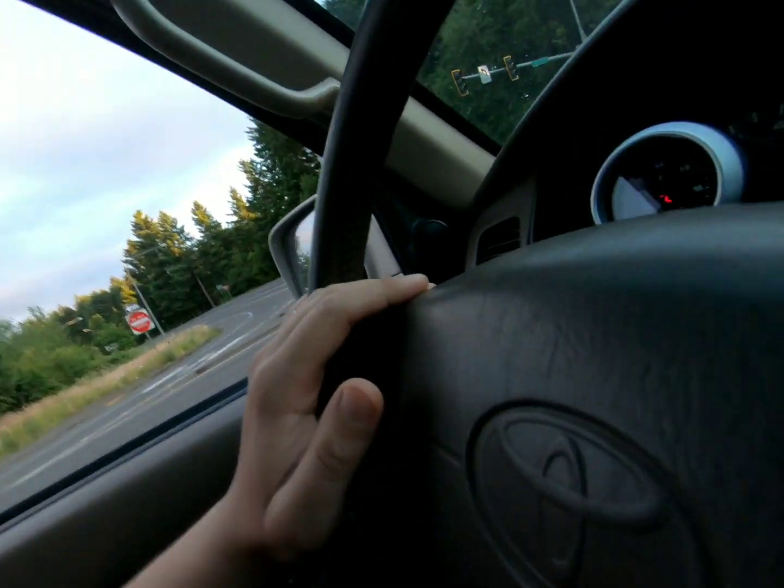So there's conflicting stories with this, and some people it does work. Some people, stock ECU works. Okay, I'll admit that, but I'm just saying mine didn't. So if you plan on turboing your 4runner, even supercharging, you should get a wideband for sure. And before you play with too much boost, make sure you're getting enough fuel. What else? Let's make another hit, huh?